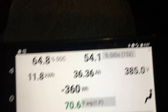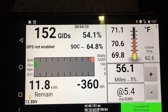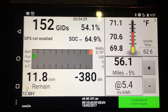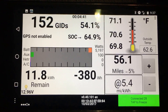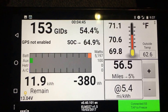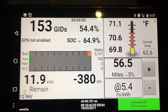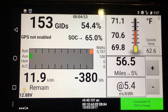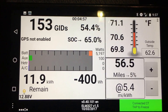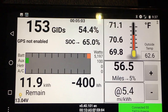Other uses include — I think this is the most useful — for people that have a 2011 or 2012 LEAF, you don't have a percentage state of charge indicator. All you have is the stupid guess-o-meter, as we call it, on the right side, which has distance to empty in miles or kilometers. It doesn't know anything about your future driving — it only bases it on some recent history. So it goes all over the place, going down more than one mile per mile driven on the highway, and on city streets it might go up. That's terrible.